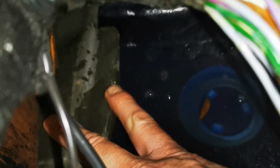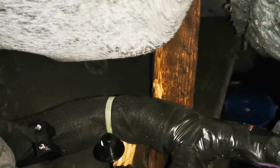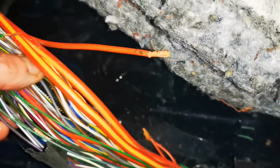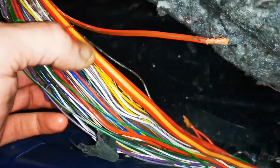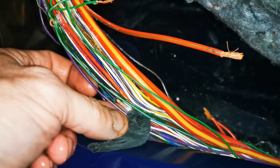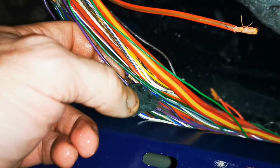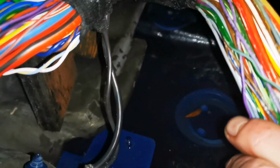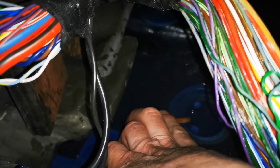is soaking. That's soundproofing up in there, and yeah, I've just got the carpet hoofed up here with the front seat still in, and this is all just pulled away, just to prove this is the fault, and that's our problem. All the other wires seem okay there. Well, that one, that big one, and that one. So anything that seems to have these exposed connections, or may as well be exposed, they're just wrapped with this cloth tape in here. So if water gets in here at all, this is our problem. It's floating about there. There's a wee boat.